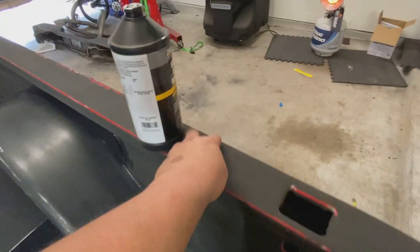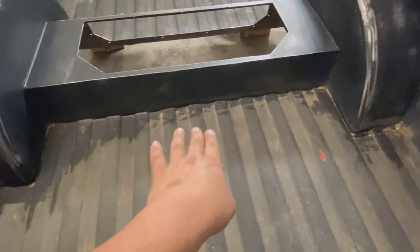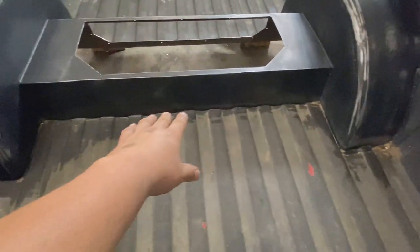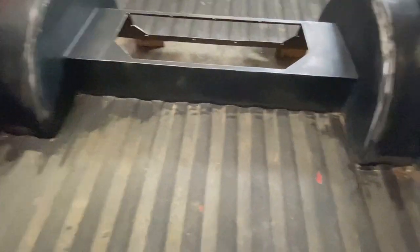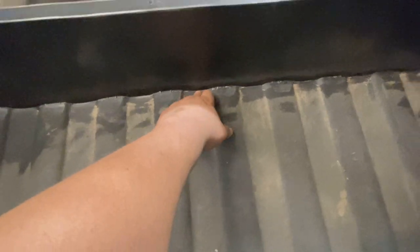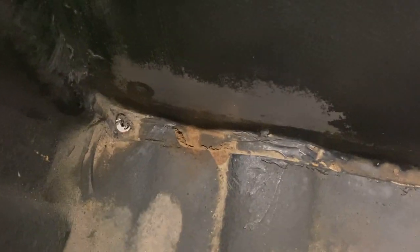Alright, well we got the notch pretty much everything sanded down. We went over it with some wax and grease remover like three times already, and I vacuumed it a little bit and knocked off some of the dirt. Now I do plan on drilling some holes back here, because whoever did this notch before put two drain plugs on each side - two drain holes. But there was so much dirt caked up on this side that there was so much water sitting here that it wouldn't drain through. So I'm thinking of going ahead and drilling some more holes, at least in each one of these little valleys, just to keep the water out. If you got standing water in here, you're going to start to get rust spots.